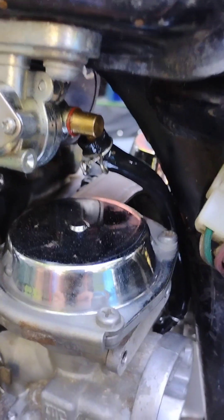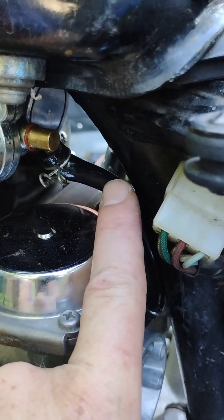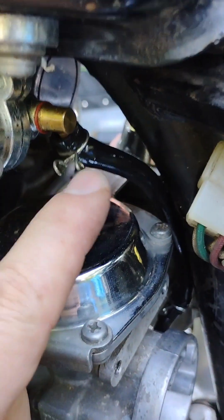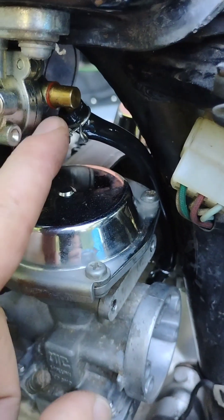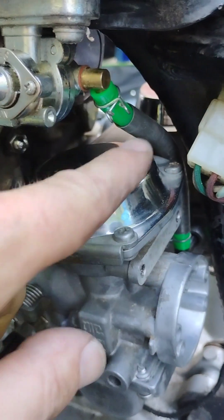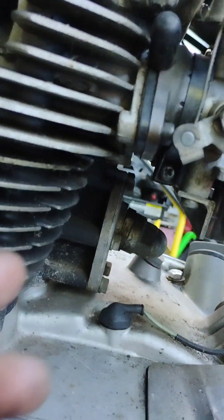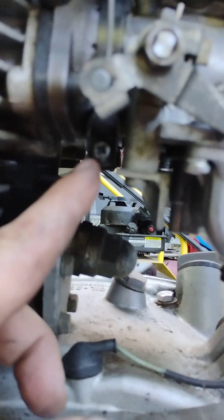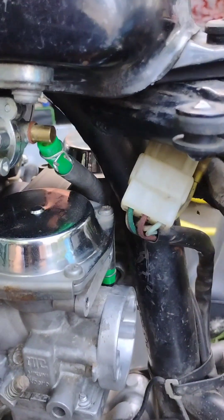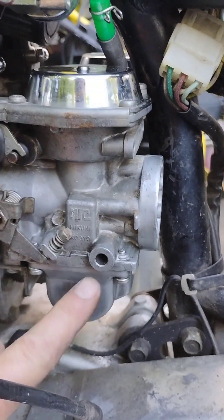This makes a perfect teaching moment — I thought I could get away with this line right here. It's a little crusty, a little stiff, but it wasn't terrible. But when I turned the gas on, it just leaked all over. So I went ahead and ran a new piece of fuel line from here down to this T right down in there so that we're not leaking any gas on this motor. There's the fresh line, got it hose clamped there, wire clamped there. And since I had to take the carburetor off to do that, I went ahead and put my hose clamp screws down here as I was telling you to do. So everything's back to really fresh and new, and we'll turn this on and get gas going back into these float bowls.